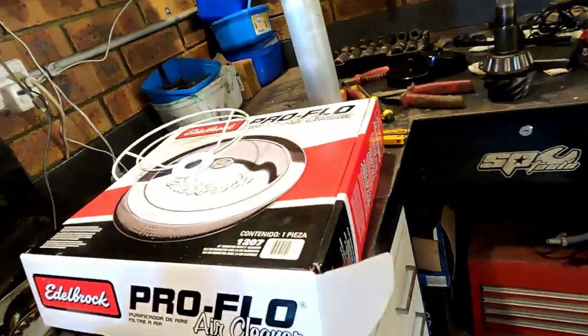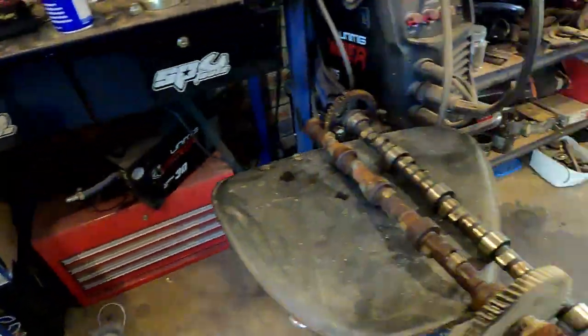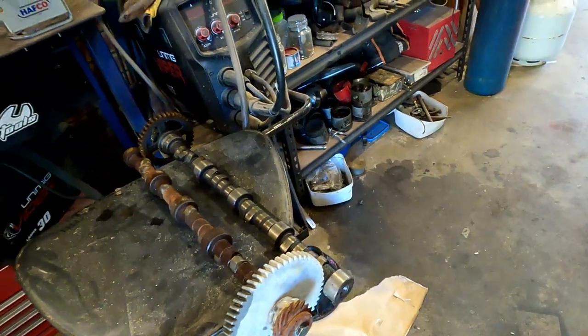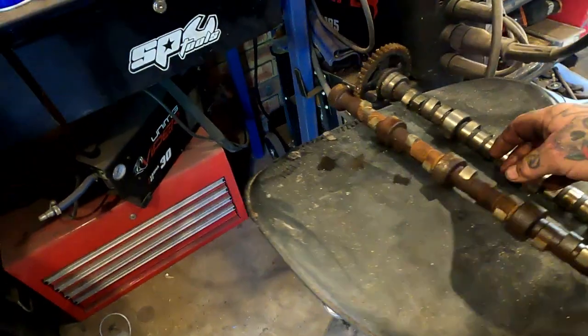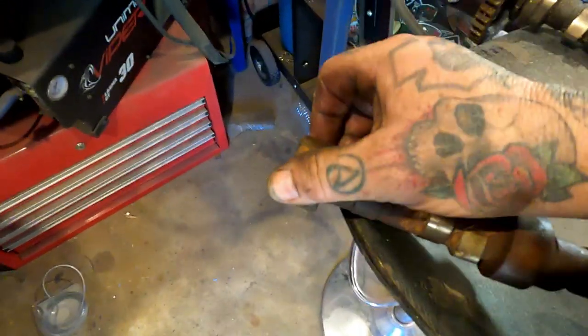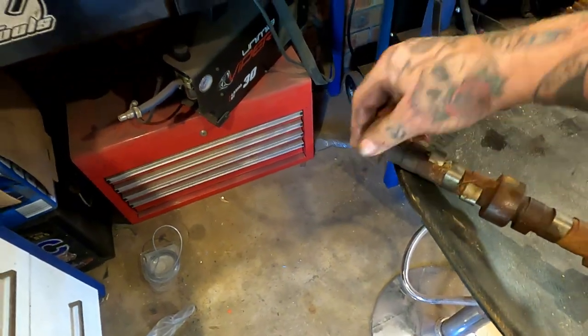Anyway, that's it for the day. I thought I was done, but I thought, no, while I'm out there, I'll get that other cam out. Had to swing the hammer really hard, but it ended up budging. You can see where it was locked solid in, particularly that end there. Because that end had a Welsh plug on it, so any moisture that got in there didn't come out.